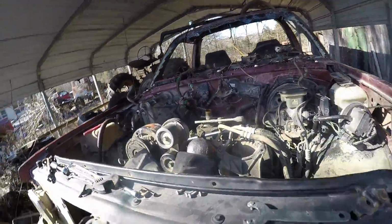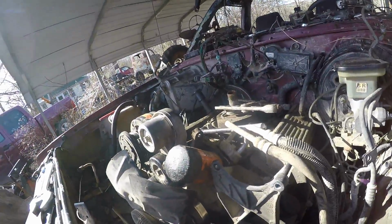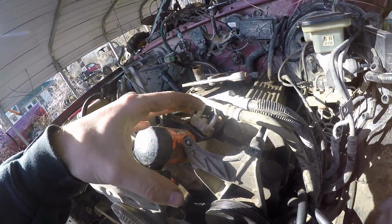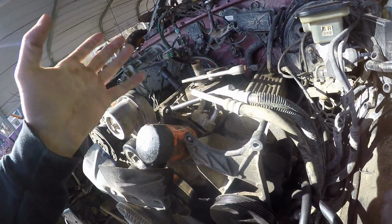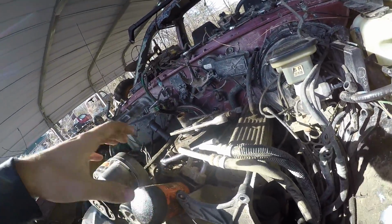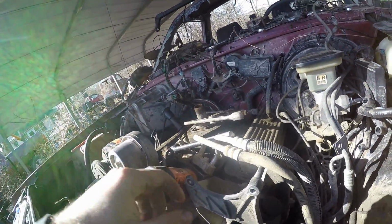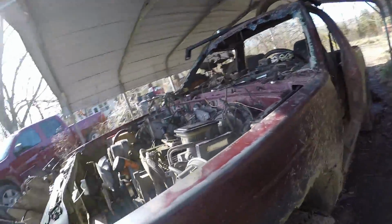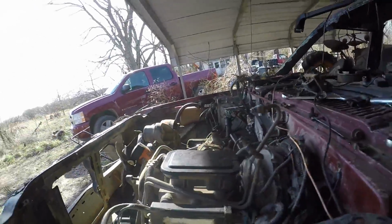After that, we just got to pull the oil pan off this motor, pull the oil pan off the 305, and then weld the bottom. I don't really know exactly what you call it. I guess the sump part of the pan off from the 4.3 on the 350. So, well, 305. But we're getting there. So I'm gonna get to work, and I'll be back in a little bit.